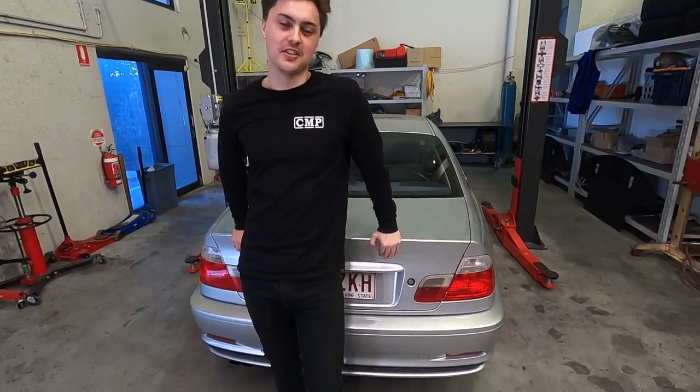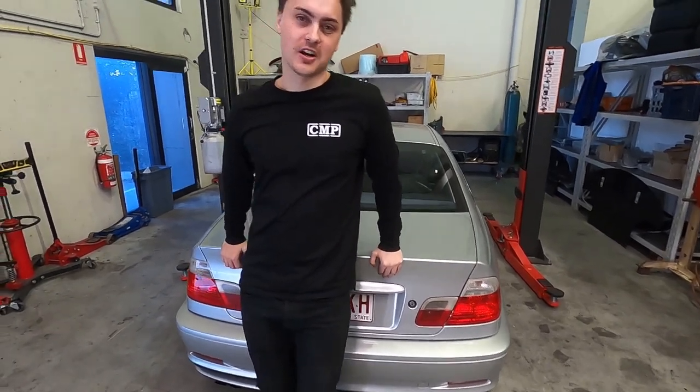This is a 2001 E46 320 Ci and the first project for the channel. This car is a whopping 288,000 Ks and we're going to start by dealing with some of the cracking issues these chassis suffer from. So the first part of that process is going to be putting it in the air, dropping the exhaust, wheels and removing some of the boot trim. So let's get to it.